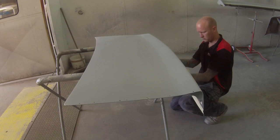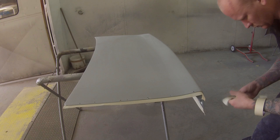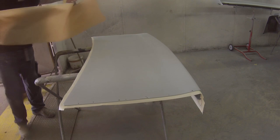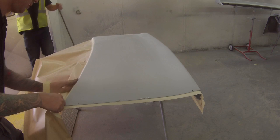This is all I'm doing here — just a really simple back mask. I'm using 36mm 3M masking tape; it's not quite as big as 2 inch — I think 2 inch is a bit overkill, but some people prefer the wider tape. I've actually been requested to include how I back mask a panel that I've already painted the inside of, so this is just a pretty simple process. Get your masking paper roll with your piece of tape on it on that masking machine, pull it out and put it over.